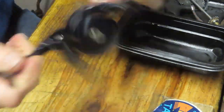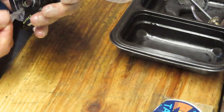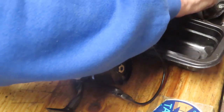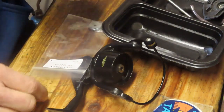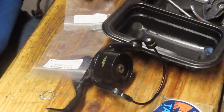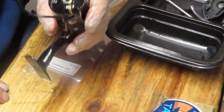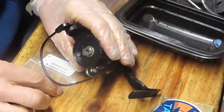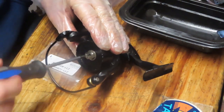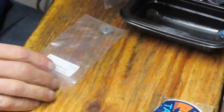Give it a spin. I'm optimistic now because that's spinning nicely. I'm not hearing any bad grinding, and I think we'll be able to do very well building the bottom end. We've also got that rotor tie-down clip — I noticed when I was taking this apart that the screw was missing, so let's go put that back on. Get the clip, find where the hole lines up, and set your screwdriver right in there. That'll keep that top nut from breaking loose as the rotor is spinning.